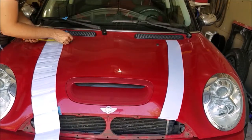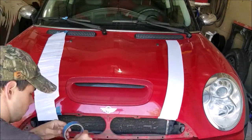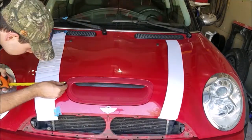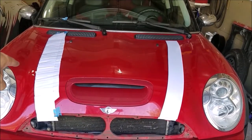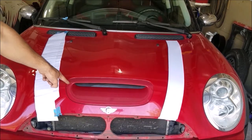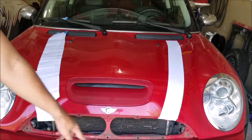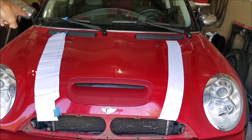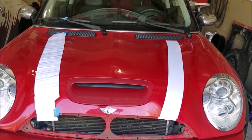I have the two stripes positioned: two and five-eighths of an inch from the top line on the intake scoop, ten inches from the edge to the center dot of the emblem, two and three-eighths inches between the windshield washer nozzle and the top of the stripe, and they're in the same exact position at the honeycomb grille. Everything is lined up pretty perfectly.